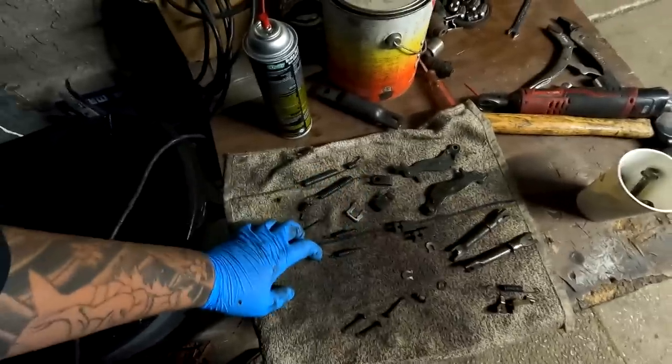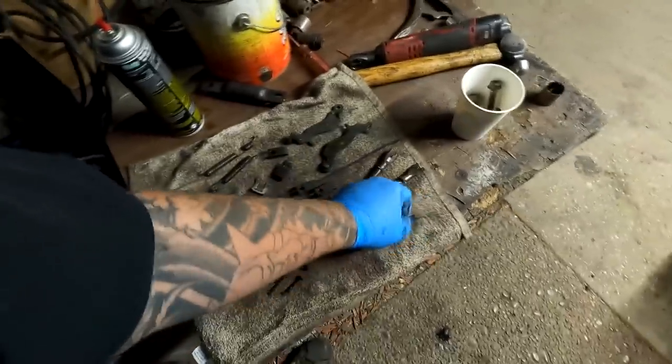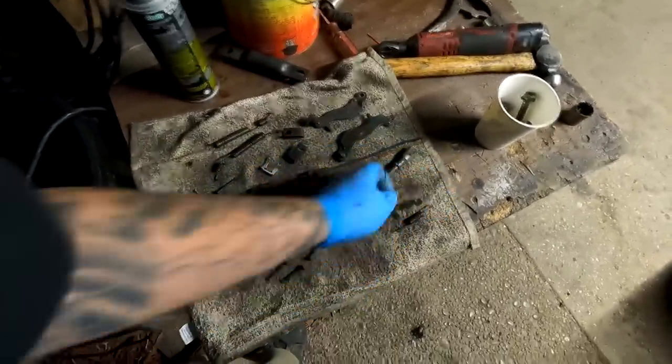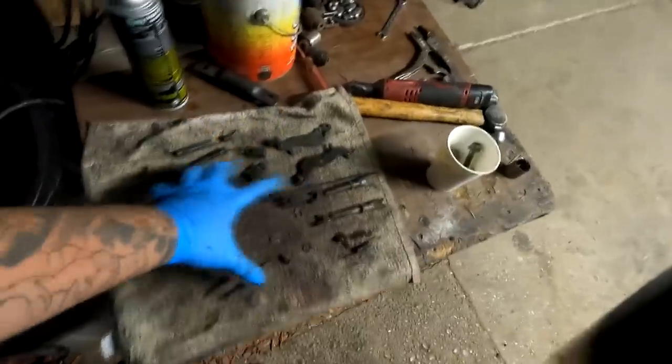So it looks like I can only assemble the brake assembly on one side fully, while the passenger side, I'm gonna have to go and find this in the junkyard, because I definitely do not want to install the drum without this, because this is what keeps the clevis from rotating and actually locks it in place. So I am gonna only do, I guess, in this video just the driver's side, and I can't complete the whole entire brake system anyways, because we still have to do the entire front in order to bleed the back and then drop the car. Yeah, that's the plan. Do the front, bleed the brakes, then drop the car. So I'm gonna go ahead and just grab everything I need for the driver's side, and let's get all the new parts installed.